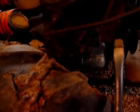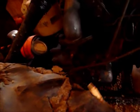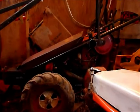Okay, that's off. And I believe there's a little Allen head screw somewhere that holds this onto the throttle shaft. I'll wait till I take the carb off to find it. It's a little itty bitty screw. And basically, to remove the choke cable, you just need a straight screwdriver. Just unhook the choke cable here. Some of these Graveleys might not have it. I know the 59 over there does not. See, it has the older style with just a little lever on the side there.